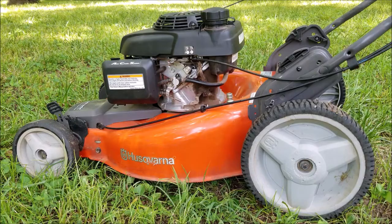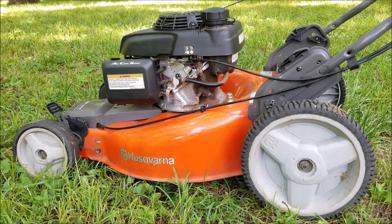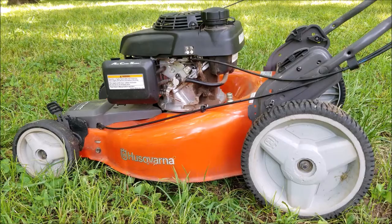To keep this situation from happening again, I would suggest replacing the air filter every year along with the oil. If you don't want to change the air filter, I would suggest at least shaking it out once in a while. So my question is: how often do you replace your air filters on your lawn equipment? Once a year or just whenever there's a problem? I hate to say it, I don't change mine very often at all. Thank you for watching — I really appreciate your time here. Please feel free to ask any questions and I hope to see you in my next video.